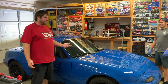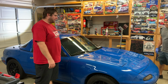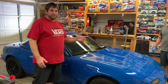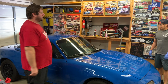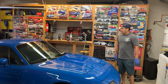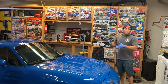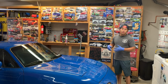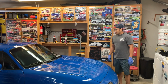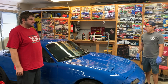We spent some hours, some buffing, some pizza. We've finally gotten to the point for the next step. We're gonna throw on some coats, like a protective coating. But first, what we did to get it ready, we cleaned it. So what do we use to clean this thing up? Basically, we did an alcohol bath solution. What that does is it gets rid of the remaining polishes, the compounds that we used, as well as oils, grease, and remaining surface dirt. We want to get this surface as clean as possible before we lay the coating on. It'll bond that much better.